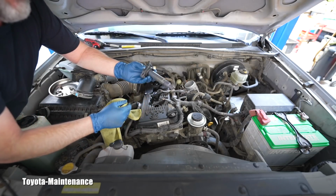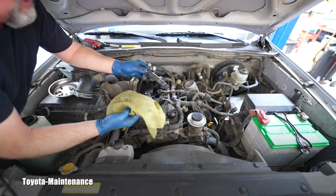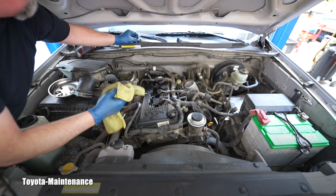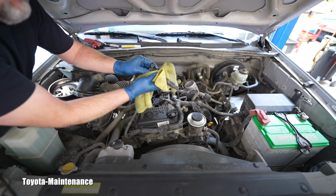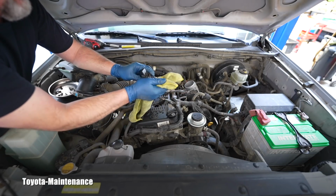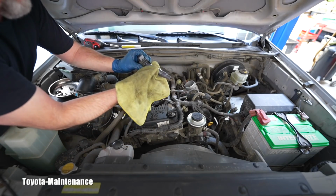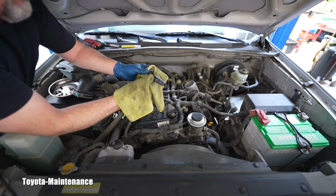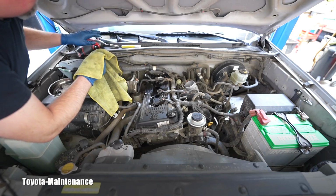This I had out because there was an inspection last year for the owner. So number 1, I pulled only number 1, so hopefully there will be no presence of oil in the different tubes. It's number 2. This I feel comfortable putting over there. It shouldn't hurt anything. Number 3 also, no oil, perfect. So we don't have a problem with a valve cover gasket, which is not just visible on the outside, and it will be only in the tubes. So far at 188,000 miles, these coils are all original. They never failed, or if they did, the owner bought original Toyota, but the dirt on them, the way they look, all original.